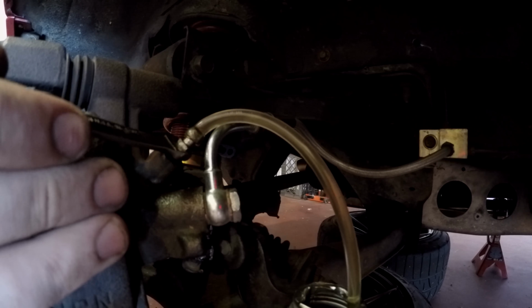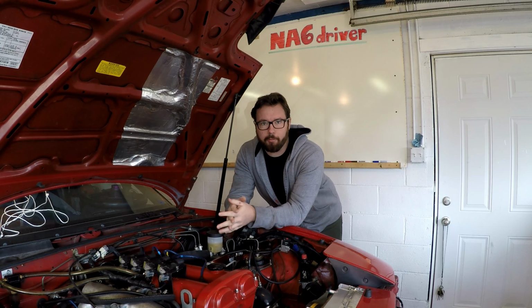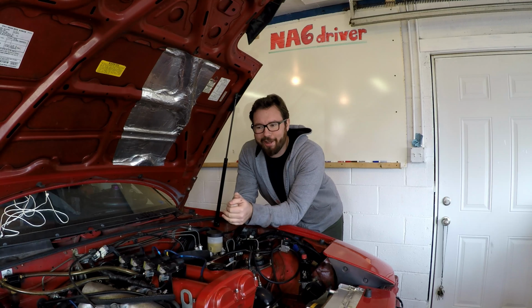Oh yeah. Well guys, that's all there is to it, to changing a master cylinder in your car and bench bleeding. Hopefully this is helpful for some of you guys, and I know this is a pretty common thing to have happen on any car of high mileage or older, up in years. I showed you as much as I really could about how to bleed the system. I don't have a speed bleeder. I just enlisted my wife into it and had her pressing the brake for me and holding it down whenever I opened the bleed port on the brakes.